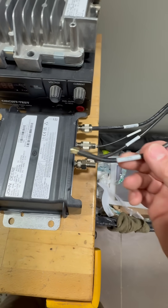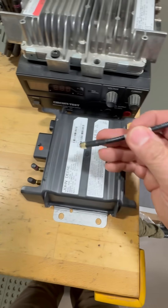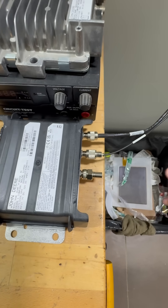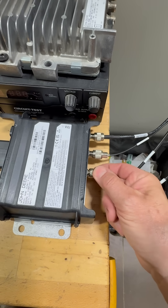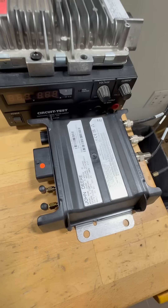You may have a Wi-Fi connector also. If you have an antenna with four connections, just hook it up to this one here. If you only have two, just put them in these two here and leave this terminator in place — that comes with the modem.